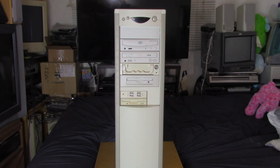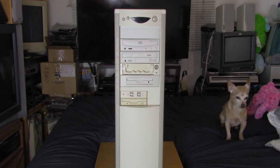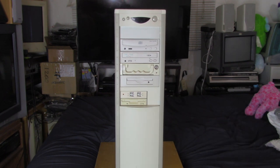For older OSs like DOS and Windows 95 and 98, it's pointless. The gimmick of the dual CPUs just is pointless, since those operating systems just don't support the dual CPUs. So the whole gimmick of the board is lost on that. Now, there are a few that you can use, like Windows XP and Windows 2000, and even some versions of Linux and OS/2 will work with the dual CPU. So as far as DOS and Windows 9x, which are by far the most popular gaming OSs for 90s retro gaming, the gimmick is useless. The dual CPUs just don't work.